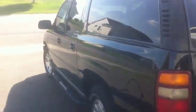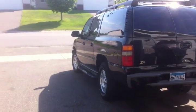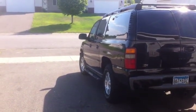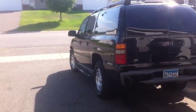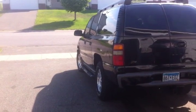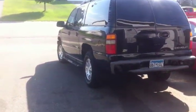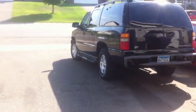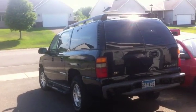And the bodywork actually turned out worse than what I thought it was when it was done. Even after it was primed, it looked good. But in the right sunlight, you can see the wobbles and the waves all over the place. Even though I was using, see that right there? That was all done with an air file. I air filed that whole area. So hopefully you can see what I'm talking about. It shouldn't be that hard to see. It's pretty ripply right there, just in the right light. You got to get in the right light and see it.